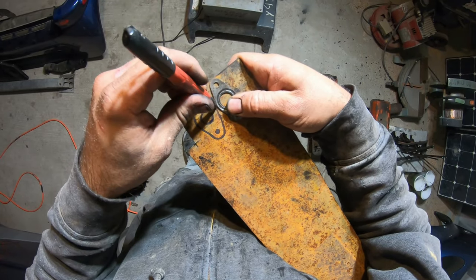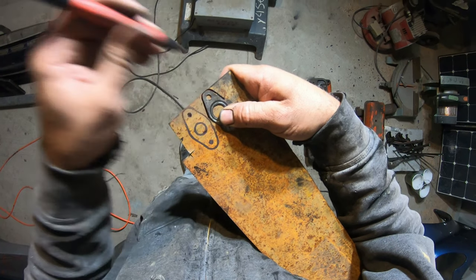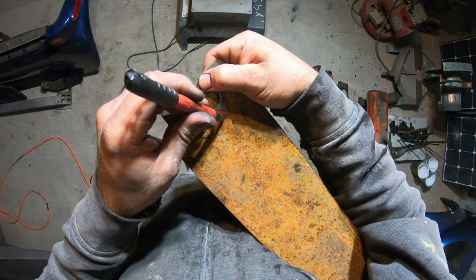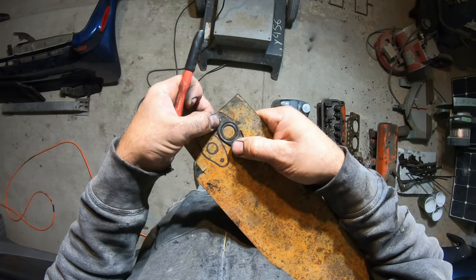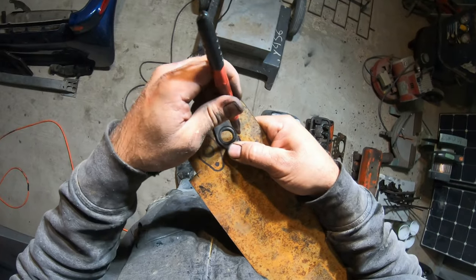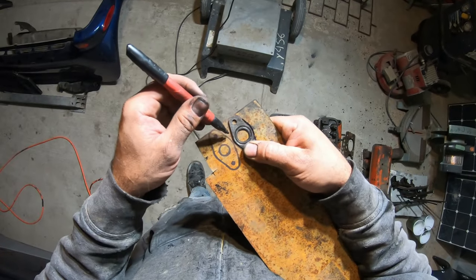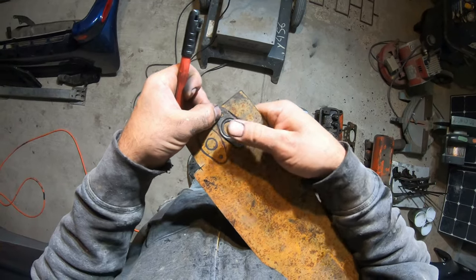And it can be a little bit bigger than your gasket. It doesn't even have to be the same shape. As long as you get the bolt holes in the right spot, then it'll work just fine, as long as it doesn't hit anything. You could even just cut it square. It's just, if it hangs past the flange on the housing for the EGR, maybe it won't fit in the space. So you can make it a little bit bigger, but I wouldn't make it too big because it may not fit in the area where it's going.